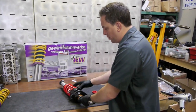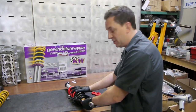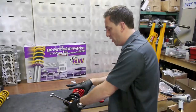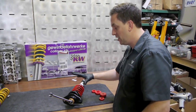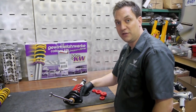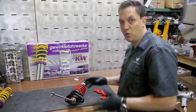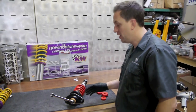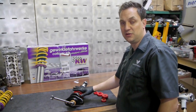You don't have to worry too much about these factory mini springs — front or rear — in terms of using spring compressors. Obviously, point the shock away from you so it doesn't uncompress and hit you. But the springs are not under that much tension, and when you get the nut fully off the shaft, they're pretty much de-tensioned almost 100%, so they won't go shooting across the room. Spring compressors aren't needed to do this kind of work.